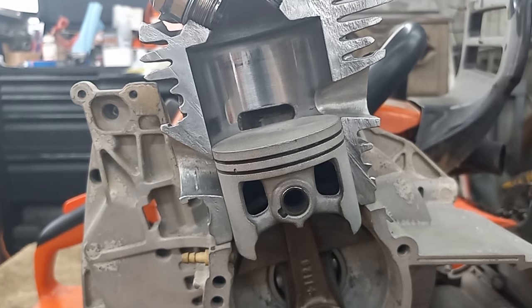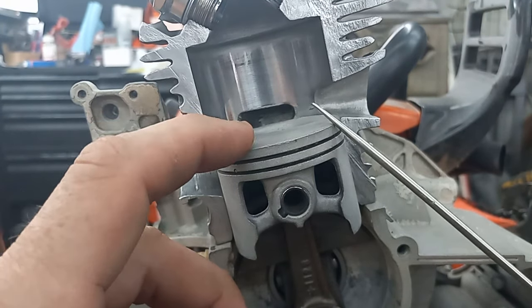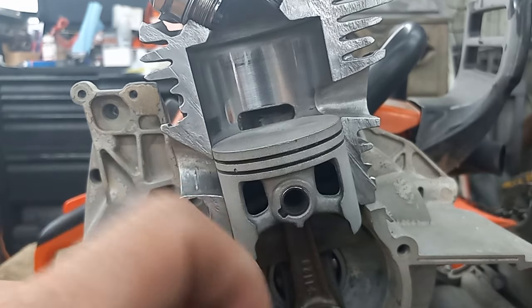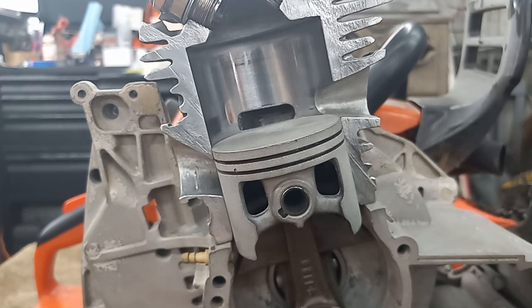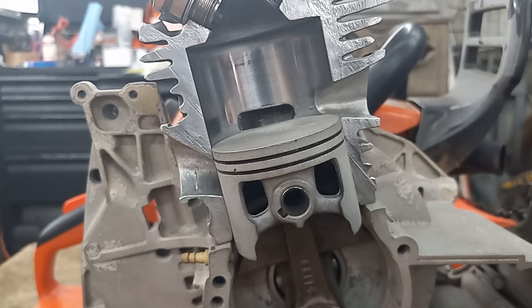On the 026 I didn't raise it back up because I didn't want to lose any more blowdown — I think it was around 22-24 degrees something like that. This is just how I port. I don't hide stuff from you guys. It's so hard to get this out of my head and across in a way that makes sense, but all I want to do is help you guys become better porters and possibly not make all the mistakes I've made. I've destroyed — I couldn't tell you how many cylinders.